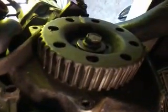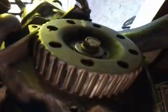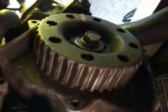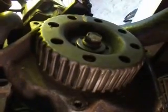in using this bolt and a 22 millimeter socket. By the way, the sprockets here use 17 millimeters, and you want to have some kind of a tool to insert in those holes to hold the sprocket while you're loosening it. We didn't do that. We had the belt on there, so we used the pressure of the belt to loosen them, and that actually helped quite a bit.